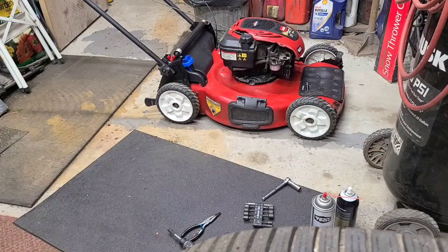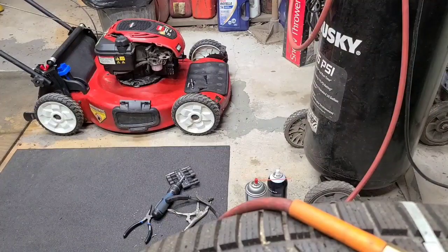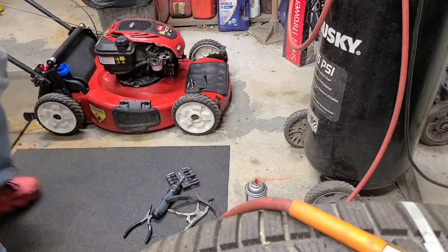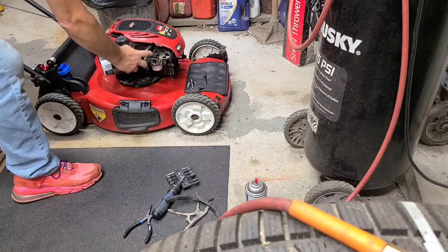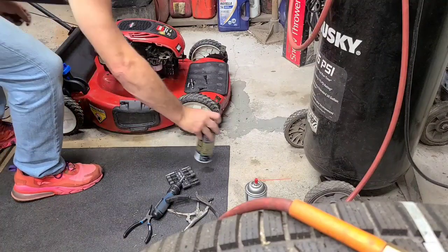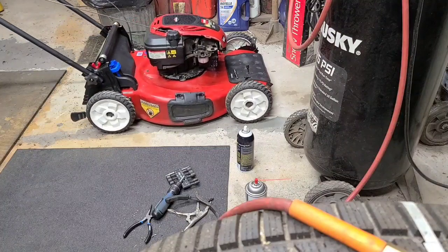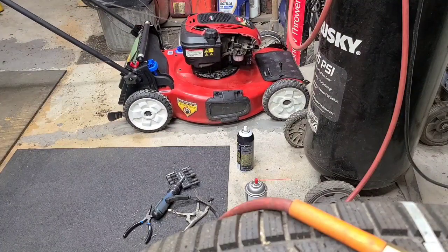All right, we're going to pause. You don't need to watch me pull this twice and make the video too long. I'll be back. All right, let's try round two of this one. Try cleaning it again. You can't get the emulsion tube out in this one. It's peened over. The only option, if you can't get it clean, is to change it.